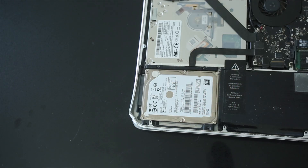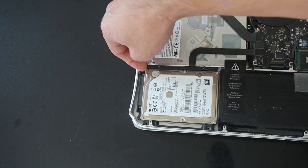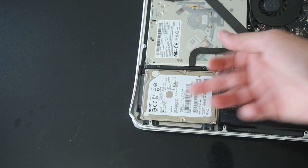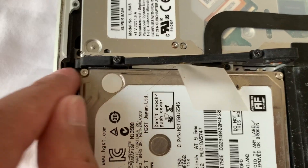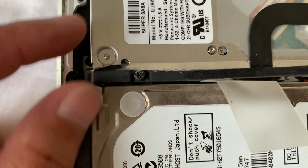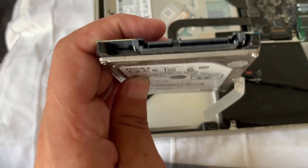So we're going to take the hard drive out and replace it with the new one. The installation is very simple. All you do is take these two screws out on the top, then lift one side up. Make sure you don't put anything sharp underneath because there's a cable that runs there. Open those two screws and lift it off — got it.